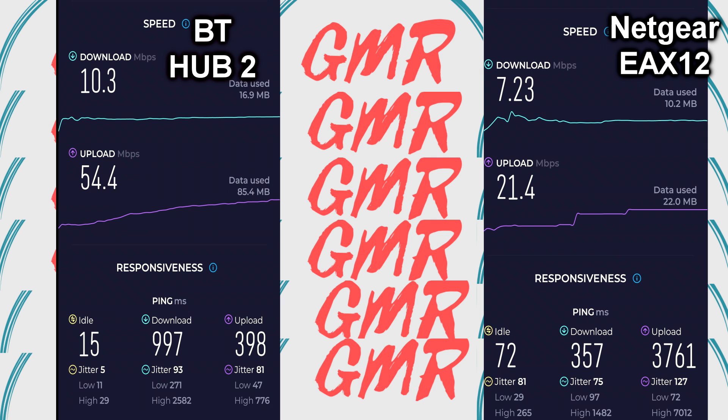As you saw in the speed test, it is not good. If you're one of those basic users who just want to get a Wi-Fi extender, set it up using the WPS button, pair it with your router, and plug it in somewhere with poor Wi-Fi — this extender is not for you. I can slightly improve things if I go into settings and split the bands into 2.4G and 5G, however then I'll have two separate SSIDs. The main reason for buying this was to have one SSID, so unfortunately in my case this extender is a big no-no. However, if you don't mind splitting the bands and having separate SSIDs, it may work for you.